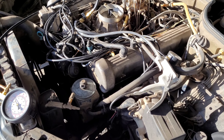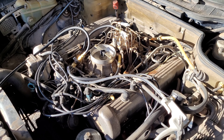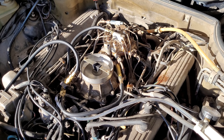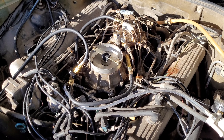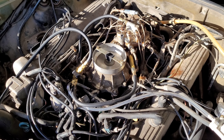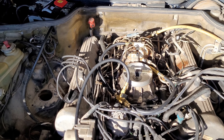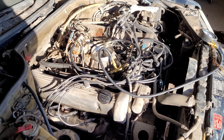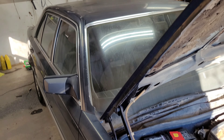I'm pretty sure the car probably won't start with as low fuel pressure as it has, and I'm just not going to try to attempt to start it yet — because I know it's not going to run right with that lower fuel pressure, even if it does start. So I'm just going to leave it at that for now and get an accumulator ordered up and get it put on there. Maybe I'll see about getting some fuel injectors for it too, to do at the same time.